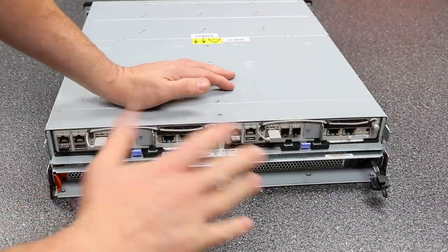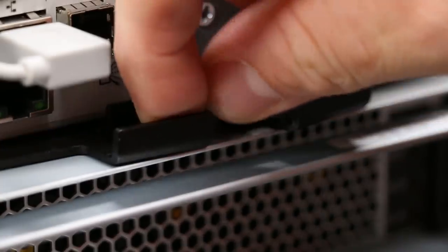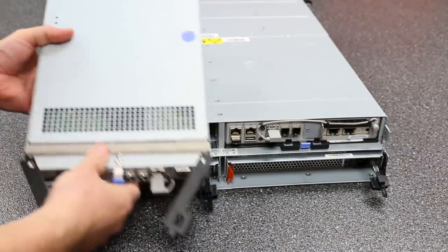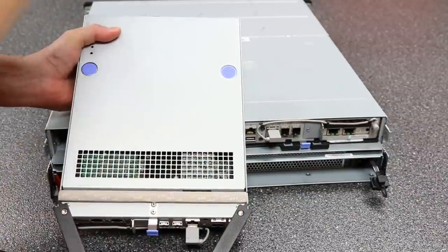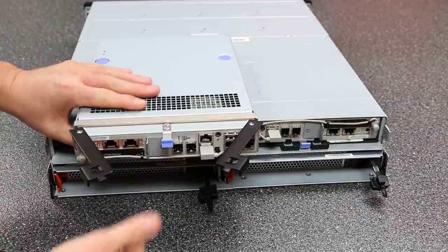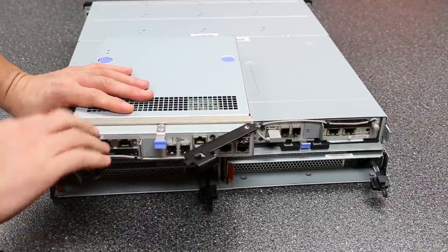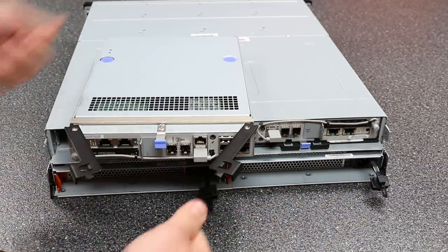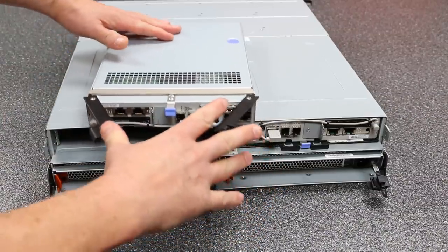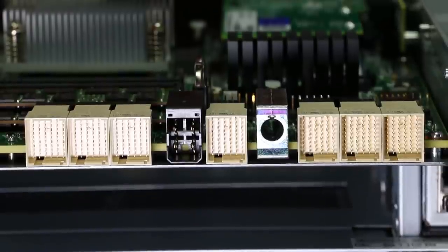On to the motherboard — lift the lever, pull these handles, and it gently slides out. There's venting on the power supply side too, so air flows through and a baffle prevents it from recirculating. The hardware is well engineered — these clips are metal, not plastic or cheap. They have stops so you won't go too far when pulling them out, and notches guide them back in. On the other side are all the connectors for the bus and everything else.